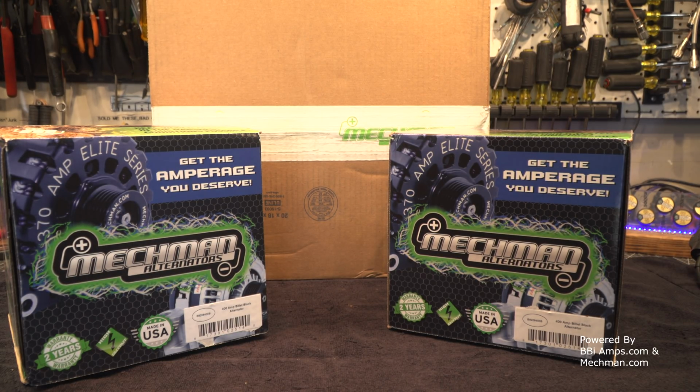That, and they would probably like to use this video as a how-to, a demonstration to their customers. Hey, instead of asking us how to install this, why don't you go watch this video? So I can't come out and go, oh yeah, we're gonna put the 800 amp cold, 500 amp hot alternator and I guarantee performance. It's not gonna happen. It won't work. I have to go to an 8-groove belt, and you're talking about changing the crank and changing the power steering pump and everything on the front end of the motor to make that work.